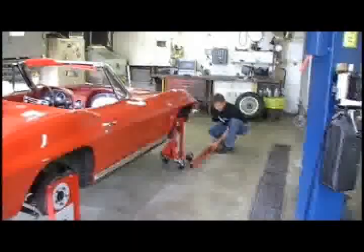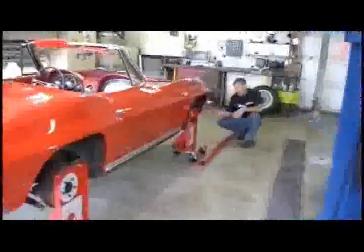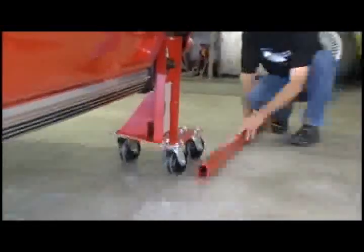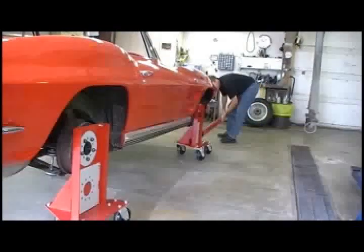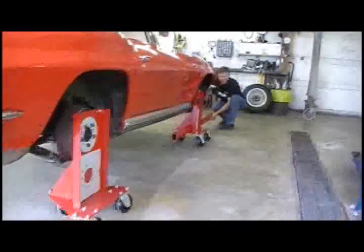So, as I explained earlier, on these wheel stands, there's a gusseted pocket in the back of these stands to accept this connector bar, which goes front to rear. So this connector bar here will reach to the back stand and the front stand, connecting the 2 stands together on each side. In order to do that, you just simply take this 2x3 quarter wall tube, slide it through the front or rear, it does not matter which way you go.